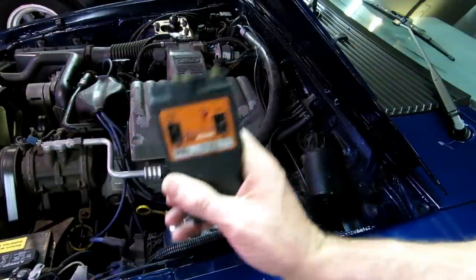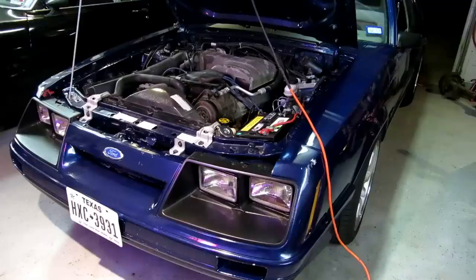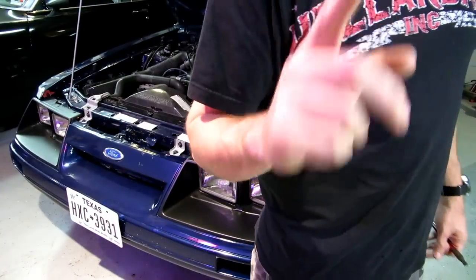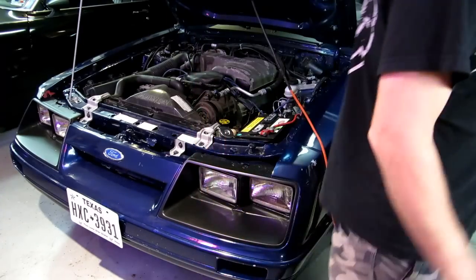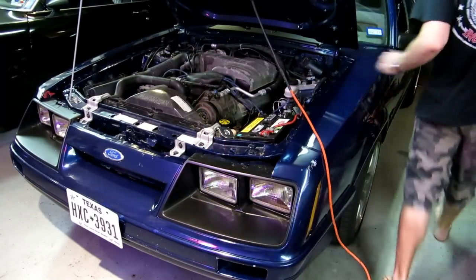Turn the test back off, then turn the key off. If you're on the super cheap and don't want to pay for a scanner, you can actually jump two wires — one from here and one from one of the terminals — with a paper clip. If you have a check engine light on your dash, it'll blink the dash light and do the same function. You can also hook up an LED light and it'll flash. You can make your own scanner if you wanted to, but I like the digital one — I'm not a fan of counting beeps. Now I'm going to warm up the engine and redo the key-on engine-running test to make sure that 21 code goes away when we reach operating temperature.